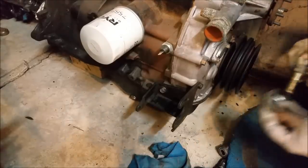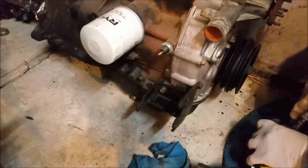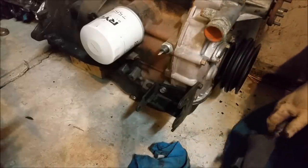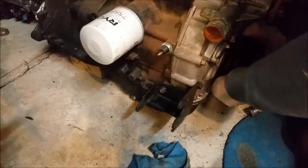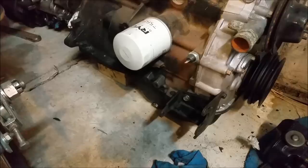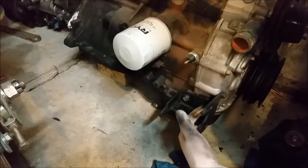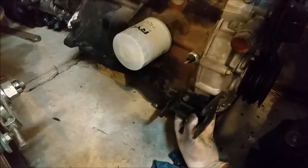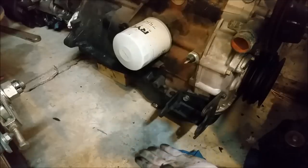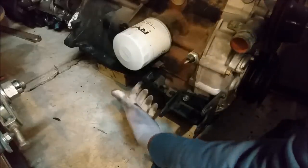Engine still turns, and I've got compression - that sounds reasonably good. So power steering pump fits on here, it goes through there. There is an 8mm thread, and the 2.6 wide has a 10mm thread, I think. I'm going to pop that on and just see where these pulleys line up, because I could be making a lot more work for myself. In saying that though, I am going to fit it. Let's get the belt on first and see if it's going to line up.